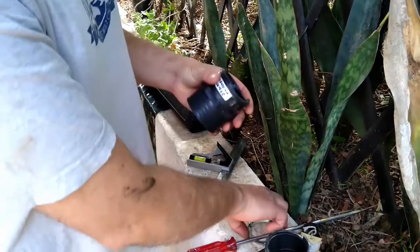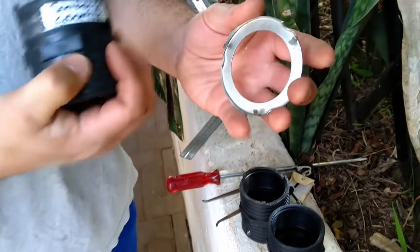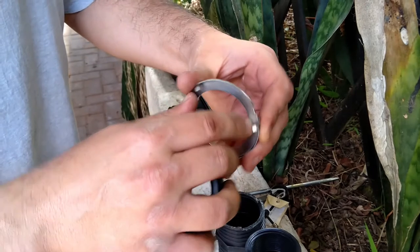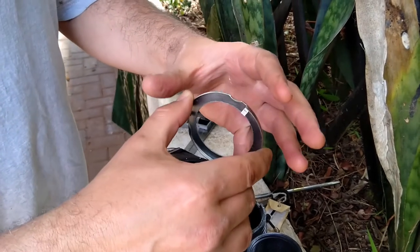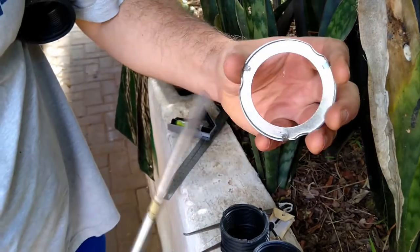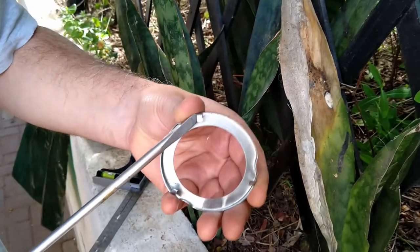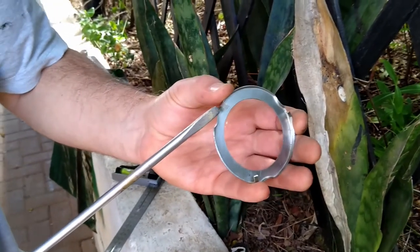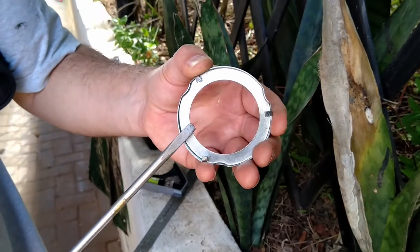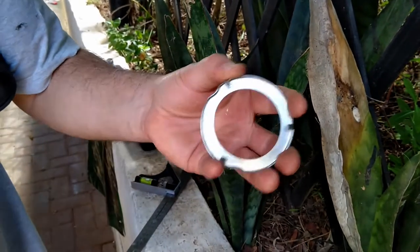All right. So just to show you, with the second prototype, how it fits together. Here's the ring. And as you know, this ring needs to be tightened on the fuel tank like that in order to clamp the washer that's on this side. And as you know, what the guys do is they knock it with a screwdriver like that to get it tightened. But as you know, it starts creating a groove there, and these pins become in danger, especially with the later ones. These aren't so strong as what they used to be made. And it starts damaging these pins, and then you end up with a problem.